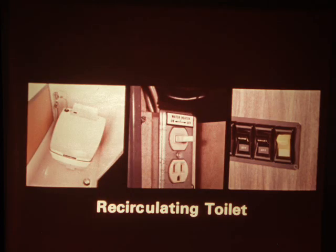If the motorhome is equipped with a recirculating toilet, charge it with a solution of 1 1/2 gallons of water and 1 1/2 gallons of non-toxic, non-flammable antifreeze. When you add the solution, be sure the water heater and pump are turned off.